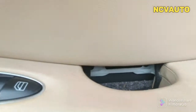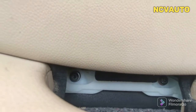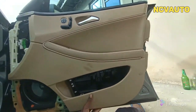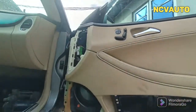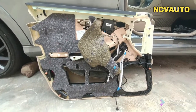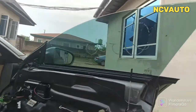Let's see what's inside. You have two allen keys somewhere around there. We have two screws we're going to untighten so the middle can be free. Gently pull this cover out and we have the board out. So that's how you remove this.